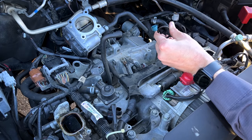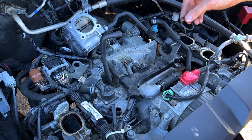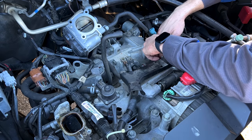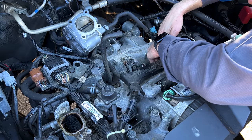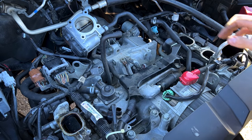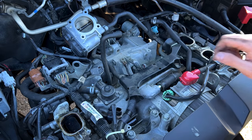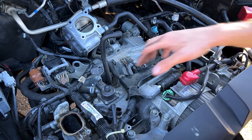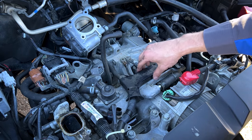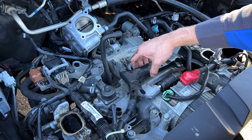O-ring number two is out, and just as brittle. New O-ring dropping in. And just like that, we should be good to go. We can go ahead and put the four bolts back in and torque the crossover pipe. Clean up our spilled coolant and go ahead and tighten up that EGR pipe nut and put all our electrical connectors back where they should be. Then put the two bolts in here and replace the rotten old zip ties that broke when we pulled up on the harness cover here.